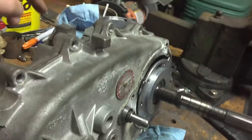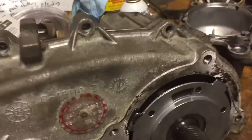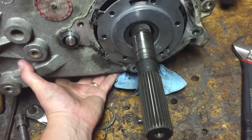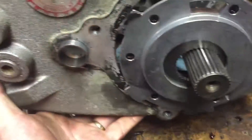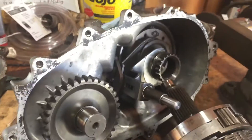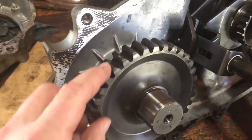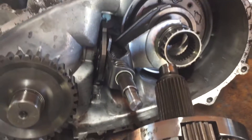That would have allowed me to get to the input shaft on that side, but whatever, that's not how it worked. Taking this off is going to bring the oil pump with it, and the shift arm slid out of it. So instead I pulled the main shaft out a little bit and then slowly walked the chain off of this gear — it's completely possible, it came off, it wasn't too difficult.